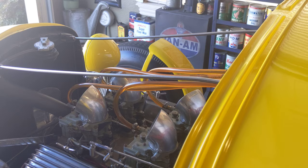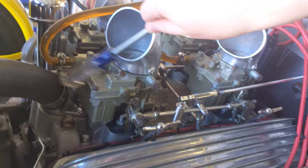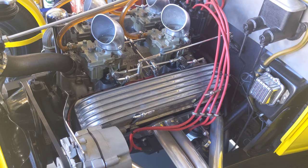You can see them begin to fill there — you can see the gas and you can hear the pump going. Fill them up a little bit. All right, that's good enough for now. We're going to turn the key off here, pull it out for safety — we don't want to leave the key running at any time. I'm going to tap these carburetors here and make sure the fuel moves up in these bowls, fills them up but doesn't overfill them. We don't want the floats to stick and them to begin leaking. They look good right now.